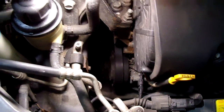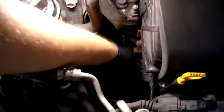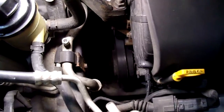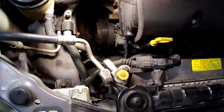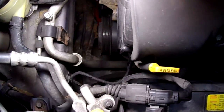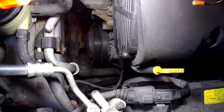The first step in the process is to get this AC compressor out. It's going to require removing the belt, and there's a splash shield way at the bottom — I'm going to have to go underneath and remove that too. I've removed the belt and the splash shield underneath so I can get a little bit of access from underneath.